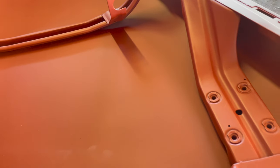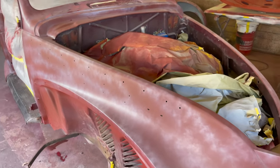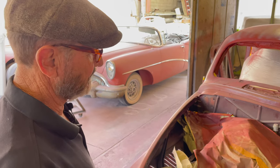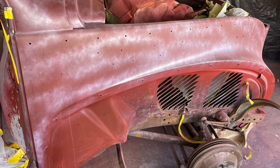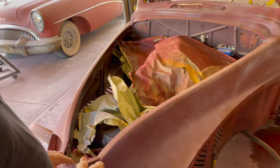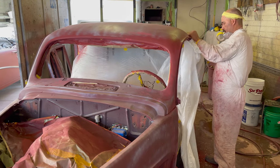Obviously we're stripped down to bare metal, but no real serious amount of filler was used. The underside of the hood looks like a showpiece — as good as a lot of people's outside of their car. The primer we got was eye-wateringly expensive. I called my supplier and he informed me that red primer is considered to be just like any other paint. In the old days, red primer was an option — now virtually no one uses it. If we use a gray primer and a red top coat, which is translucent, you're going to see through that red to the gray. We can't have that. Since we're finishing in a red color, we have to finish the car in this dark oxide red, so that when we put the translucent red on it, you look through the translucent into the red below and it's consistent, beautiful, and has a sense of depth. If we were to do it gray, it would really just kill everything.